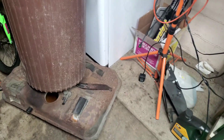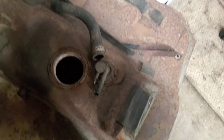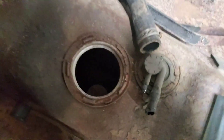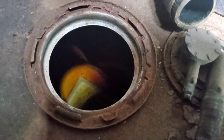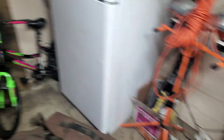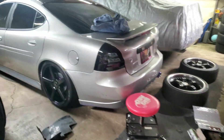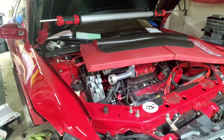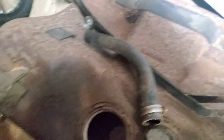Got the fuel tank in — there's the old one. I think it was fate that this had to happen; this thing was crusty, and there's the sludge in there. We got the new fuel filter on too. Got the seats buttoned up. When you do a plastic tank install, you gotta get a hose filler neck hose — this guy right here — you gotta get one off the old one because it's longer than the metal tank, so make sure you know that.